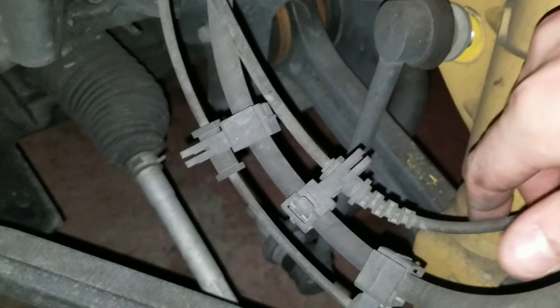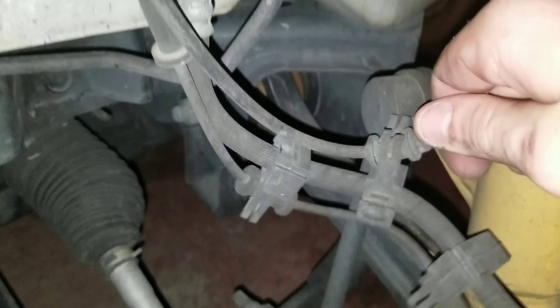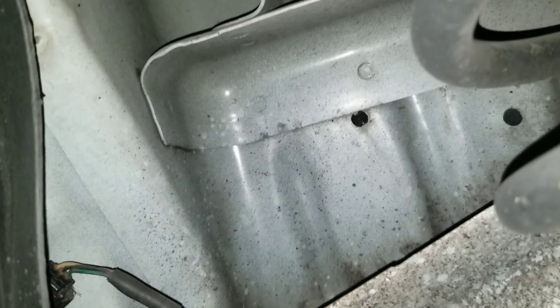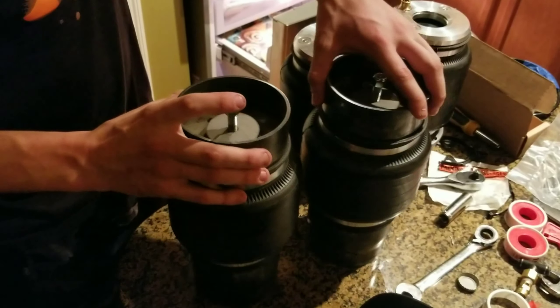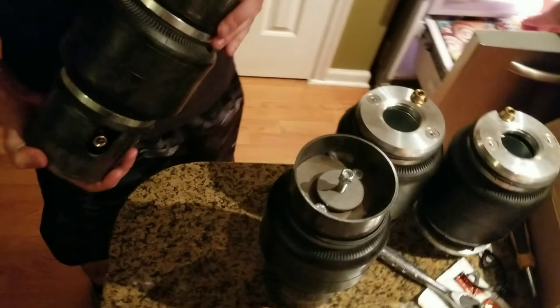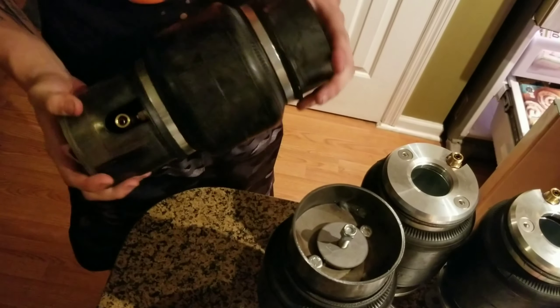For the Hellcat adaptive suspension, this right here is the wire for it. You're going to have to pull it off of this clip — there's another little one right there. Push down and pull — boom. That's what it looks like. Pull that out. This is going to be the rear bags for the Hellcat — basically a factory replacement, so you still have your adaptive suspension and you don't get any engine codes or check engine lights.